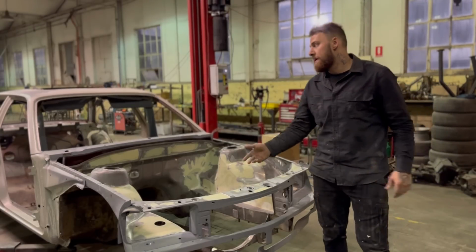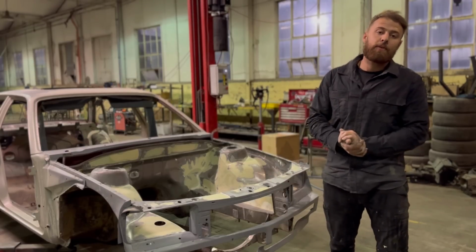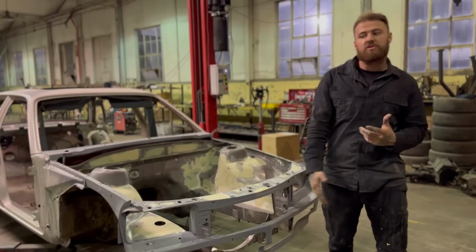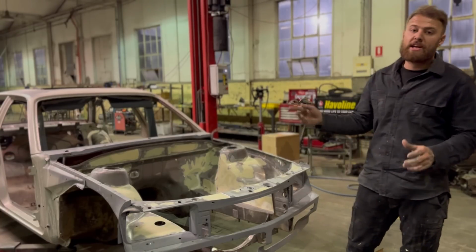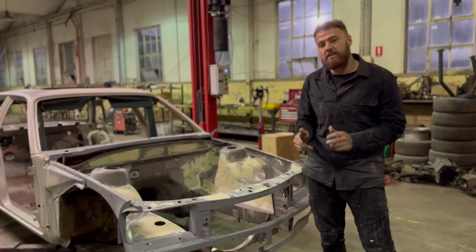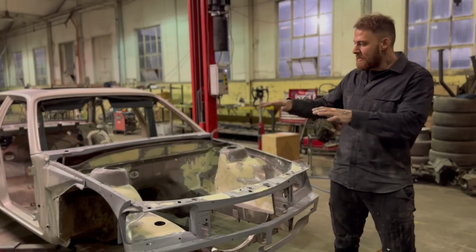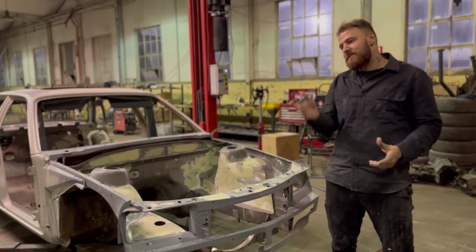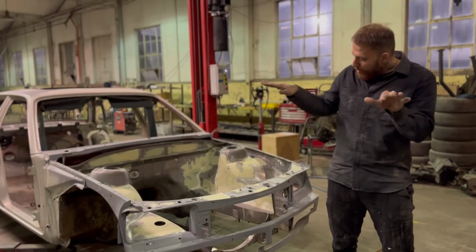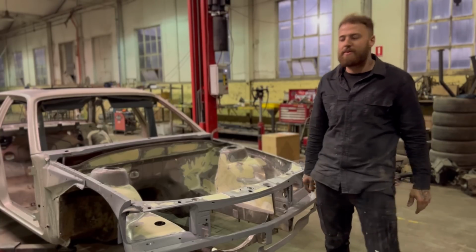Then I hit it with the, what is it called? Easy Sand, I believe. Standard filler. I like using that one. It's nice, good to sand. Get that from the body shop, and then go over all the fine edges, the cracks and the difficult areas with the Dolphin Glaze, because it's sort of a self-leveling filler that sits in the gaps and corners nicely. That is the hardest thing, just getting your fingers around all the edges. It kills you. I haven't got any fingerprints left, to be honest with you.